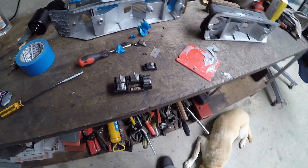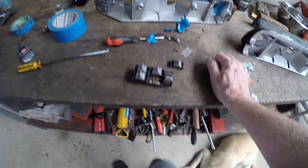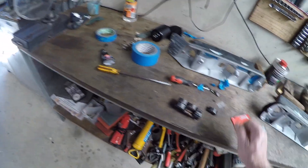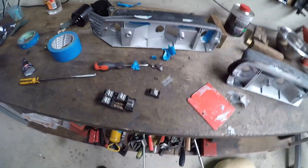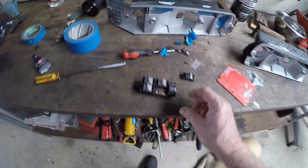I've pulled the loom out — the loom and the switches — and the whole system actually came off another car. I was at HV Lane, got a spare switch block, changed switch blocks. I put a relay in to put more voltage down to the left-hand side of the car, tried to improve the earths — all sorts of things. But at the end of the day, these switches just don't carry enough load.